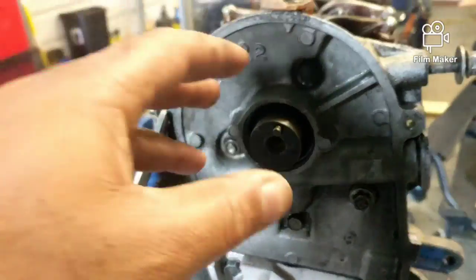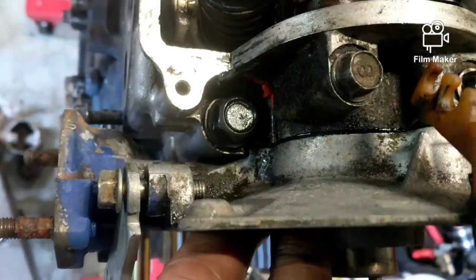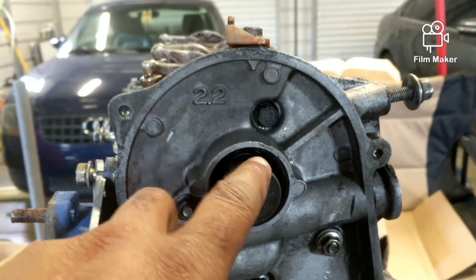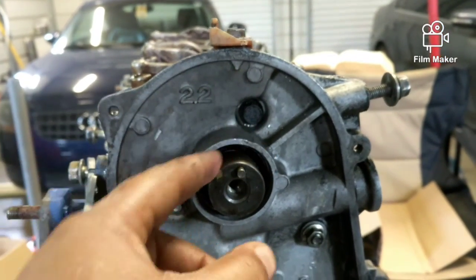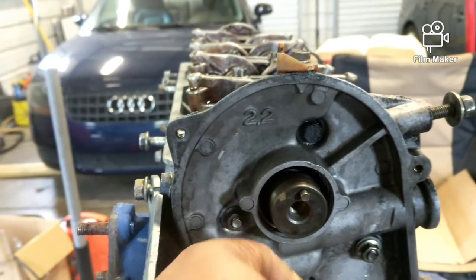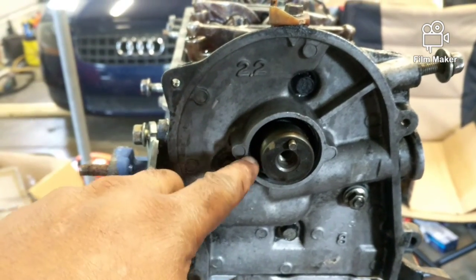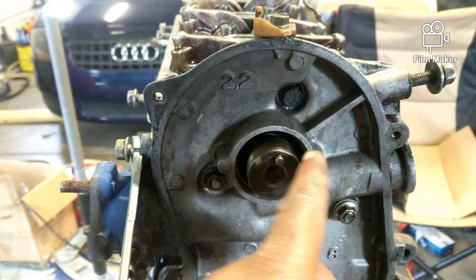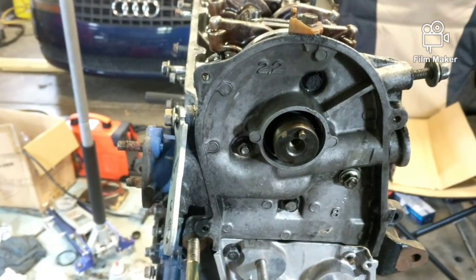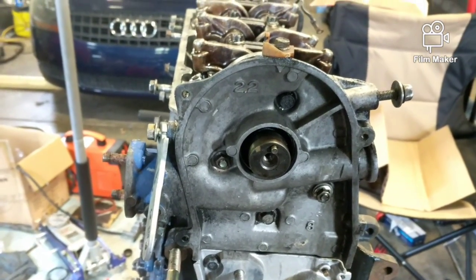All right, now this is torqued down good. Everything is seated well. Just have to put on the seal right here, the new seal. Don't forget, oil the surface of this right here, and then oil the inside of the O-ring. And I put on a little Permatex when I'm putting them in. It helps it be lubricated. You could put oil or whatever, soapy water, but I just put Permatex. It seals it and it helps it slide in.